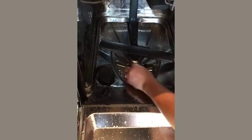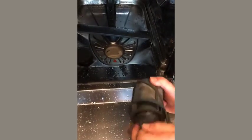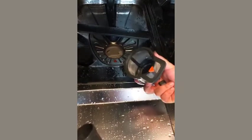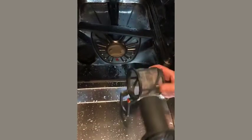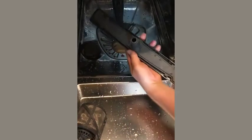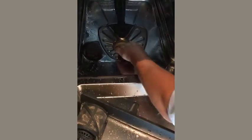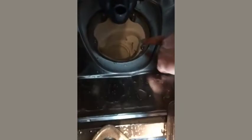Maintenance-wise, I can get in here, rotate that, and lift this out. This is the filter strainer — if I pull it apart, these are just regularly cleaned items. This stops bits getting through into the drainage and clogging up the system. Regular maintenance means having a quick inspection to check nothing is in there. You can wash all of these manually in soapy water. You can also remove further sections for any minor cleaning and to access anything that might have got stuck in there. Make sure the machine is turned off before you clear things out manually.